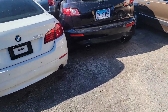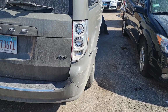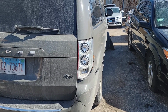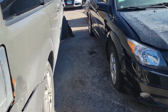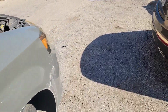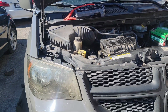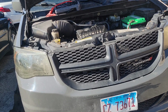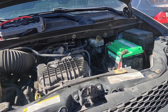There's a couple American vehicles that came in that they're not familiar with. This is a 2012 Grand Caravan, right? Whenever you would go to hook the battery up, the battery cable would start getting hot and would start smoking and sizzling real bad. Well, there's only two components in the system that could cause something that bad to happen that viciously right away. That would be the starter or the alternator. Well, we took a shot in the dark and wanted to do process of elimination, one of the two, or a major short.